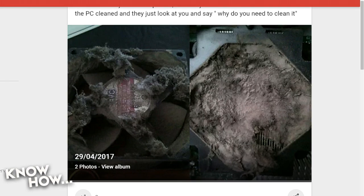It wasn't like oily dust. Yeah. It was hard, like clay dust, basically. It shorts stuff out. It gets conductive. But, you know, the biggest problem is that it absolutely will stop a fan. So now you have zero airflow over the things that are getting hot.